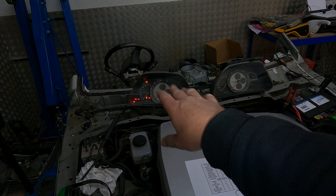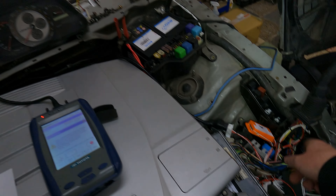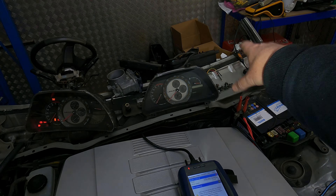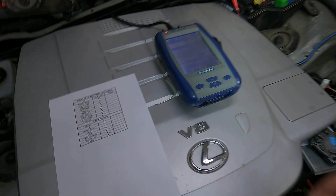It's super simple — the other side of those wires goes to ground. So if you want to add a different steering wheel with paddle shifters, no problem at all. The wires will run inside the vehicle — it's left-hand drive so they're right there — then through the clock spring, one side to earth, the other to these two wires.